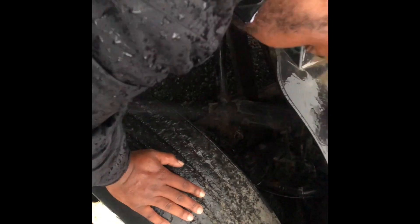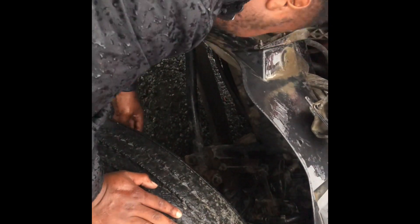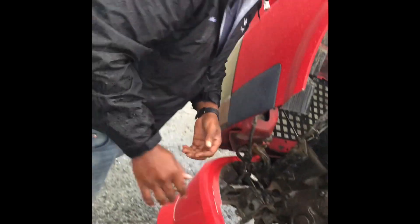Inside of the tire — got the brake drum, no illegal welds, not cracked or broken. Brake pad — properly mounted and secured, no less than a quarter inch thick. Got to make sure the edges are square and not rounded.